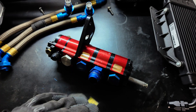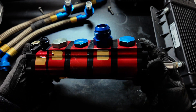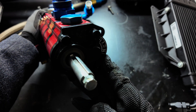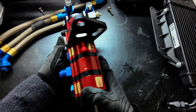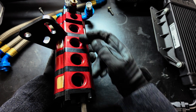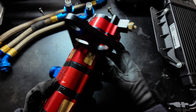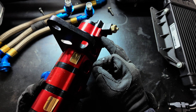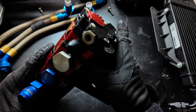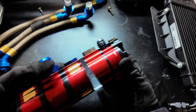This particular pump came from a NASCAR team. It was manufactured by Barnes, and it consists of modular pump segments. These pump segments serve a dedicated role, each applying either suction or supplying pressure to the engine. It's currently configured with four scavenge stages that are tied together with a common outlet. The pump also has a dedicated pressure stage which provides the oil supply to the engine, and it's fitted with an adjustable oil bypass so consistent and predictable oil pressure can be achieved.